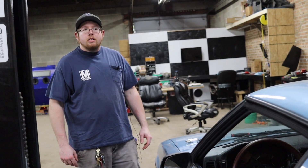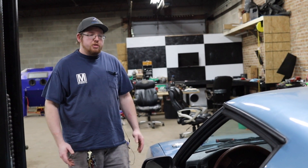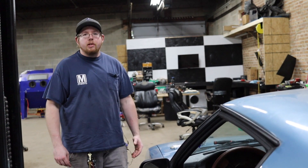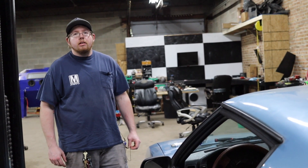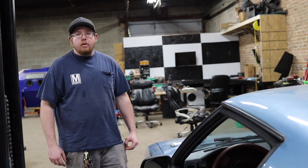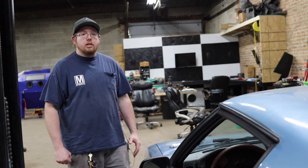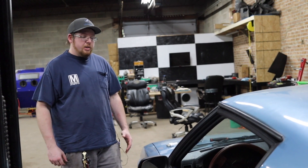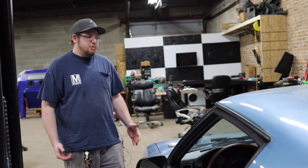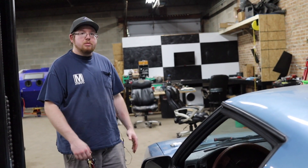Can it run on four leading plugs? Yeah, you can run it on four leading. I wouldn't do it long term, but if you needed to get it around just to transfer or move garages, I would do it. If I was going to go beat on it at a track all day, no. But that wouldn't be a reason for an engine not to fire — it'll still run. You could actually run the entire vehicle off of just the leading plugs; you don't even need the trailing to be running. When I do diagnostics, the first thing I do is just disable the trailing and see what happens — it'll run 100% fine without the trailing plugs.